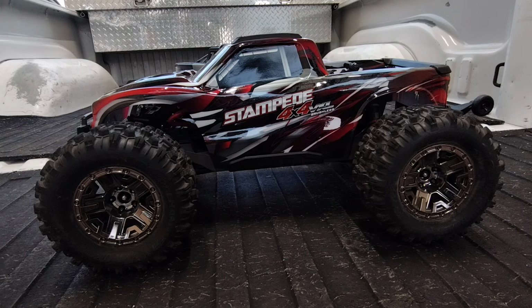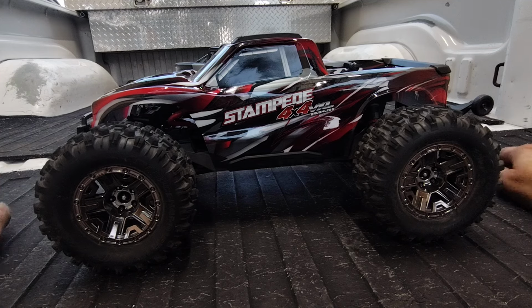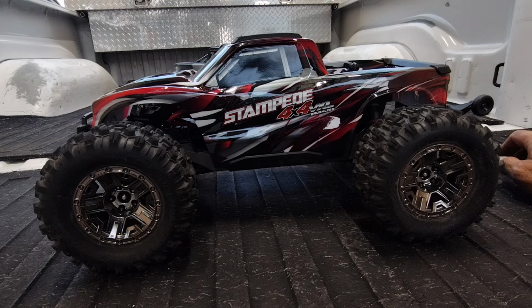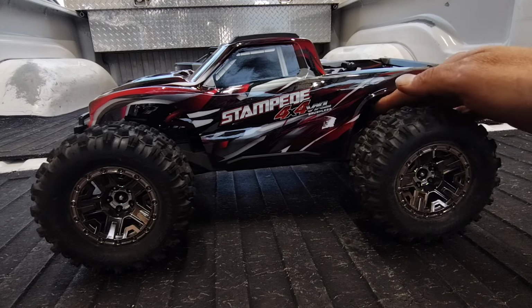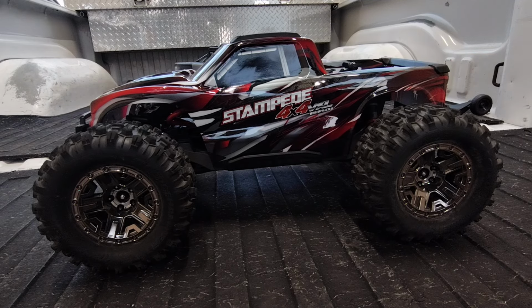I don't mean like, oh, they put like 25%. No, these were bone dry shocks. So I said, you know what? Forget this. Went ahead, put some shock oil in it, ran it. Still like, oh, okay, well, still a little squishy to me. So I went back inside, grabbed the shocks off of the Hossipede setup, which are running the red springs, a little bit stiffer springs. It's running the same shocks on it, just the heavier spring and a couple of spacers on the shock. That trimmed this out perfectly.